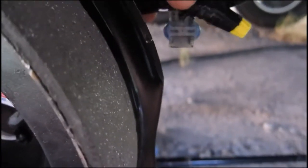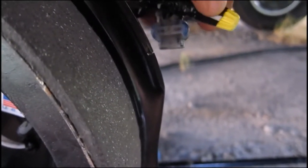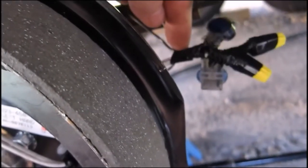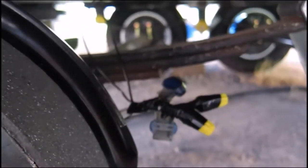When I tape, I start on the wires, then wrap around the wires, then up over the wire nut, and I do both sides. Then I tape them together and tape them back here so that the stress point here can stress on this section first. It'll be underneath the 5th wheel, so water or anything corrosive hitting it will come from road splash — hopefully that'll do the trick.